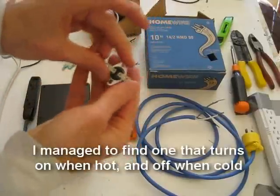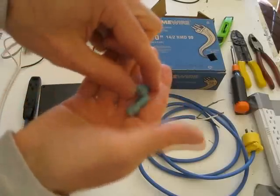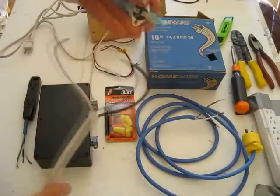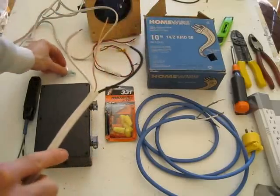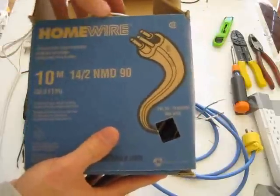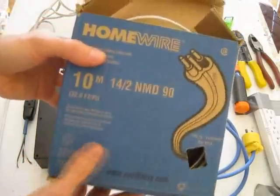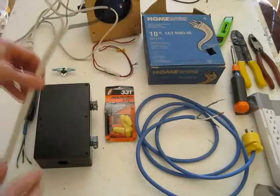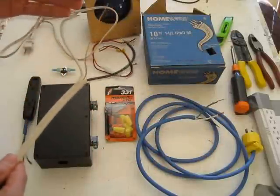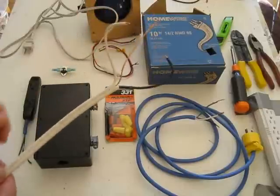Here's the snap disk controller. On the back there are two tabs or spade connectors. To wire it into the circuit, terminal disconnects are used — both female — and they simply plug in. The wire comes from a box of household wiring wire from Home Depot, the kind found inside walls in North America. It's 14 gauge wire, which is required because the breakers at the panel are 15 amp breakers, so the wire must be thick enough to handle 15 amps. Since this circuit plugs into the wall, a short could push 15 amps through it, and this wire prevents that from melting.